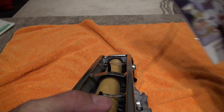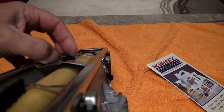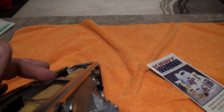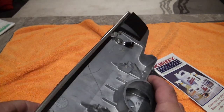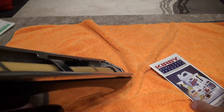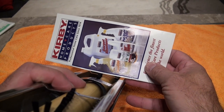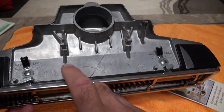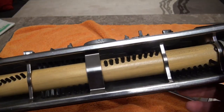We'll do our comparison again, and now you can see it's back down below the bristles. That belt's not as close to the bar either. If you wind it on the setting that isn't actually a setting, that belt will rub on the bar as well, and it'll feel quite stiff when you try to lock it and put it back in. To check whether your brush roller needs adjusting, all you do is put a ruler across — if your brush roller is flush, it's worn down, so drop it one notch. These used to have colour coding on the ends — red, green, and black — but now they just have numbers.